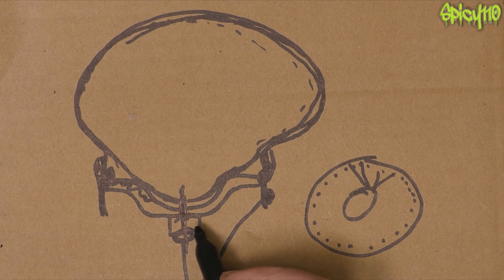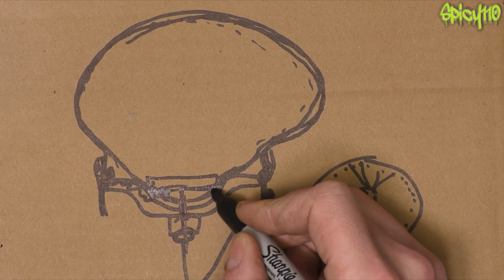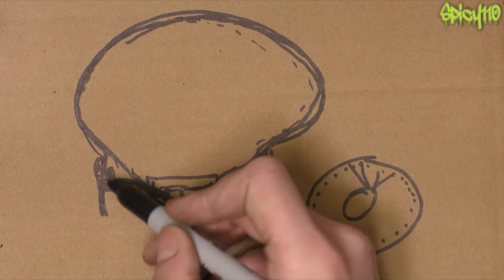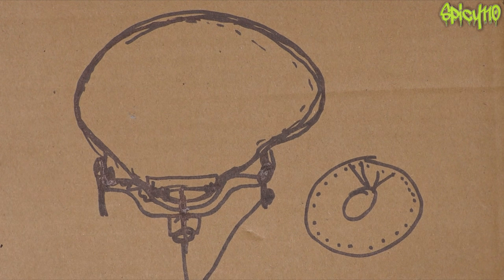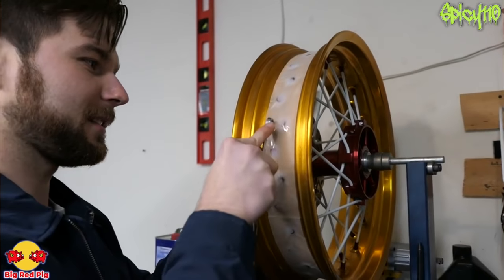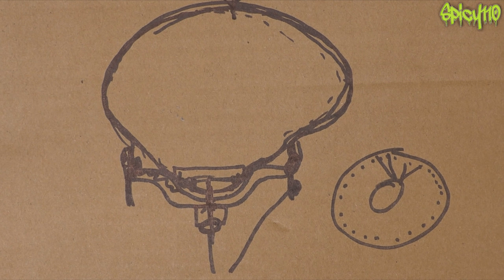There is another way to achieve a tubeless spoked rim: you use a standard spoked rim and put self-adhesive tape across the tops of all the holes, sealing all the spoke holes against air getting out. Then you don't need a tube because the air stays in - the bead radius is enough to make the tyre stick and be airtight, and it's the spoke holes that's the issue, not the bead. My mate Jake the Garden Snake has a video doing exactly that - he's also doing a series converting an MT-07 into an adventure bike and will be doing it again. It only costs about 30 bucks for the tape.